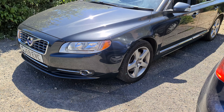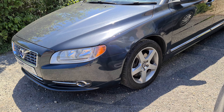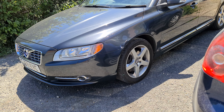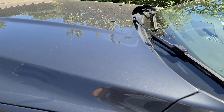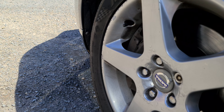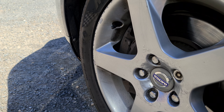I was doing some big driving, quite heavy work on the brakes, and I noticed quite a bit of fade in the brake pedal — I was having to press harder and harder to get the same feel from them. I stopped, let them cool down, carried on, and then after a bit longer I noticed a grinding noise. I pulled over, got out, put my hand about a foot away from the brakes, and I'm not joking — they were absolutely roasting. I could feel the heat from that far away, and we were probably driving at 60 to 70 miles an hour.